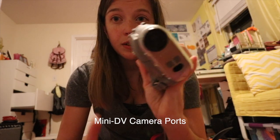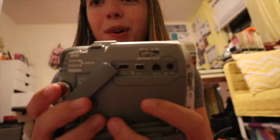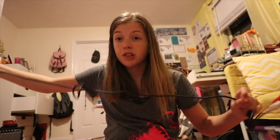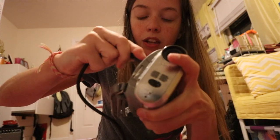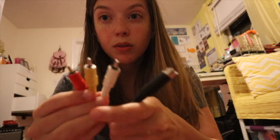If you have one of the Mini DV ones, especially this specific Handycam, it's a little different — all the ports are under here. There is no audio/video out in headphone-jack form; it uses a weird U-shaped cable. I fortunately still had this in the house so I didn't have to go shopping for it. I'll put all the cable names, the VidBox, and everything in the description links. It plugs in here and has all four RCA connectors at the end, or S-Video and left/right audio — I just do RCA, it's way easier.